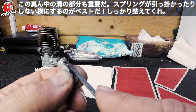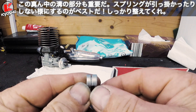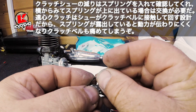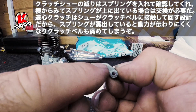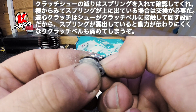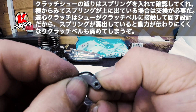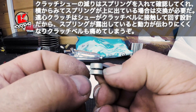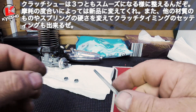File with an angle so that it sits nicely in the groove — you can see that is a nice straight groove now. The spring fits nice and smoothly in and out. What you are looking for in clutch wear: as this wears down, you should start seeing the spring. If you see the spring sitting above the clutch when it is mounted, that is where your clutch is worn out, and it will be basically operating on the clutch bell spring. You need to see the spring sitting below — like that — it's perfect, so you can't see any spring.